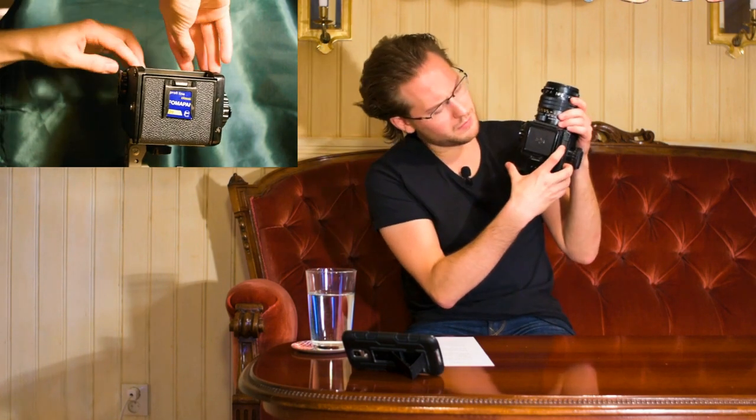There's a little red button on top, and if you look you can see a small green LED — it's the battery check light. This camera takes a 4LR44, a six-volt battery. Since these cameras had completely electromechanical shutters, if the battery dies on you, the shutter curtain would stay open and the mirror would stay in the up position. To manually release it, you press the red button all the way down and that releases the system — so you get a kind of improvised bulb mode.